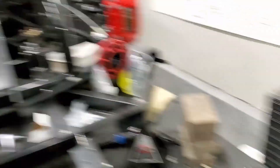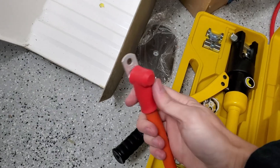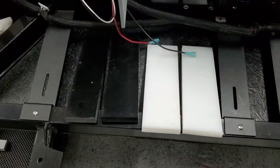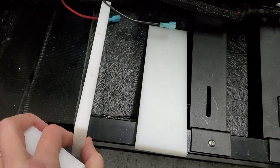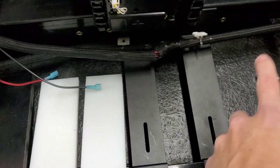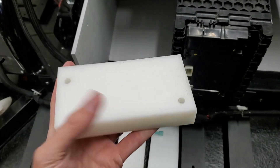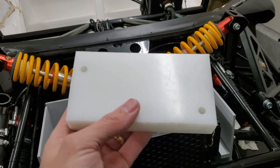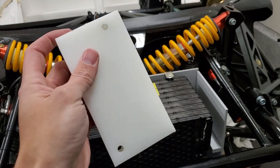I will start making up some cables. I kind of made the first one here and I've got these little rubber boots I can put over them. Hopefully I'm going to get it all buttoned up. I have been in fabrication mode — just used some scrap pieces here. This will be the spacers I need for the front of the battery box. And I also made this — it will be a pedal spacer. If you recall from the accelerator pedal, it was a little far back, so we'll go ahead and bolt this one in and see how it feels.